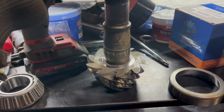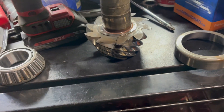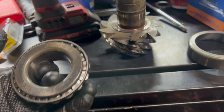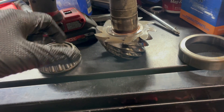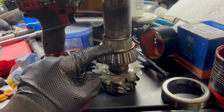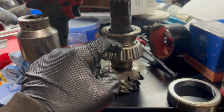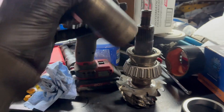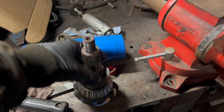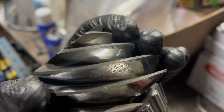Meanwhile, I'm going to cut the original inner pinion bearing so we can press on a new one. There's actually a special tool to do this, which I own and greatly dislike. So I just used a little cutoff wheel — cut the cage on two sides so the bearing falls apart, then put a diagonal cut or two in the inner race, then take a chisel and tap it. Just the heat and it knocked right off with a chisel and a hammer. Pinion's clean. Time to install the inner pinion bearing. From the factory it had one shim on it. I'm going to press it on top of that shim — the rebuild kit did come with a bunch of them. You really need to be pressing on that inside lip, not the cage — that'll do bad stuff. Did I mention this pinion's kind of horrible and rusty? It's mostly a wheeler.